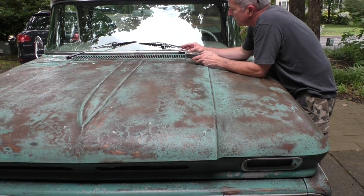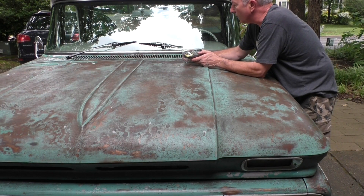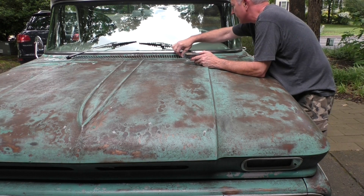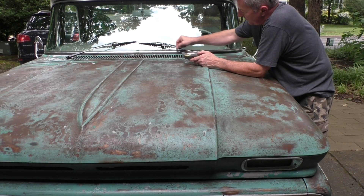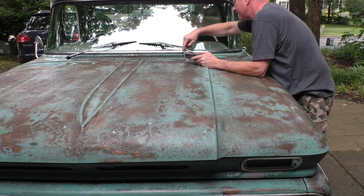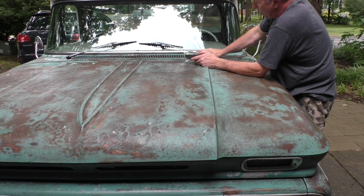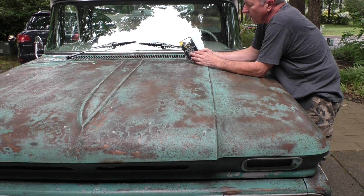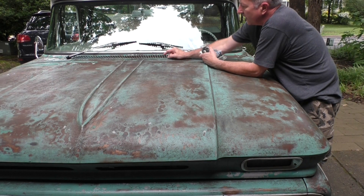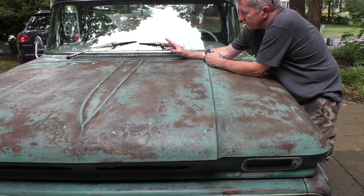So now that we have successful windshield wipers, let's see if we can get the squirters to work again. The nozzles for the windshield washers are actually inside the cowl here - there's a little metal tube that connects to the rubber hose. I thought about putting the Jeep ones on there but that would look kind of goofy. Originally this truck has kind of a diaphragm deal on the end of the windshield wiper motor inside the cab, and that's what makes the squirters work.